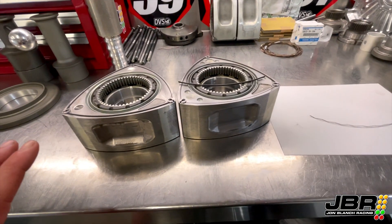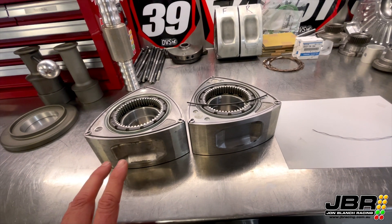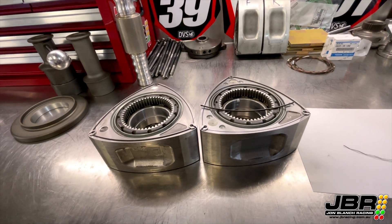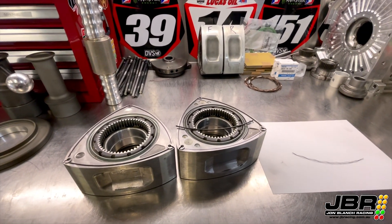So this is something that you could easily check by laying all your springs out on the bench before you assemble the rotors — if you did that you'd be able to pick it up straight away. Failing that, when the rotors are assembled it is pretty easy to figure out too. I don't know how long this has been going on, but no doubt there are probably quite a few engines already out there that have been put together with these dodgy springs in them — but it's definitely something you can keep an eye on for your next build.